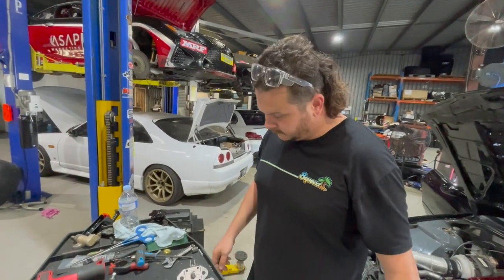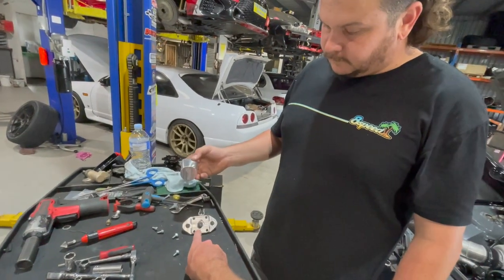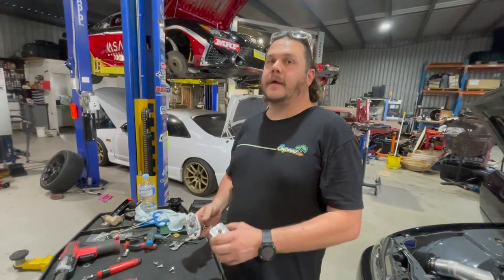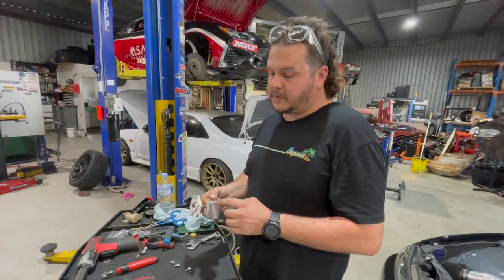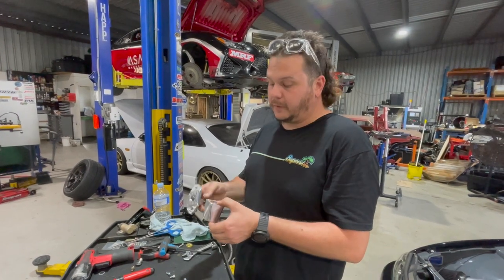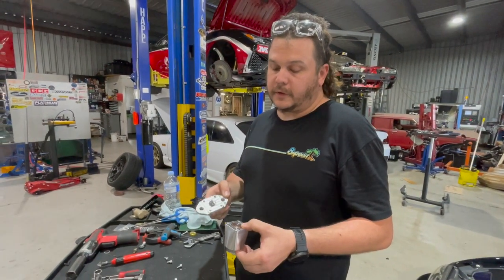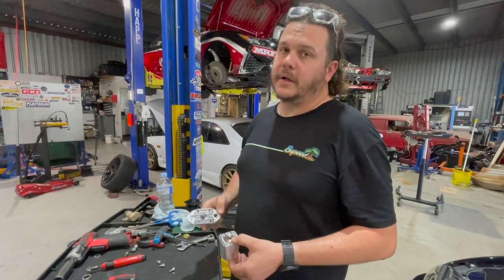Okay. And the other thing, you've changed the pivot ratio? Yeah, for a couple of reasons. First of all, to make it feel stiffer. Second of all, to make this unit shorter, we've had the spring throw less. The pedal to throw less. So it will require that on a Nissan, at least we know anyway, on a Nissan, you'll have to drill a new hole in your clutch pedal just above where the factory one is.